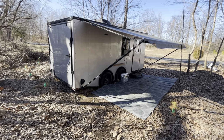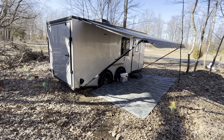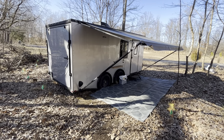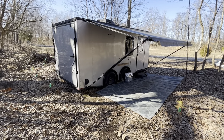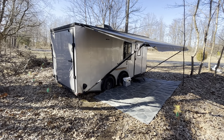As I mentioned, this is a spread axle trailer and I would highly recommend that if you have the option — in my opinion they pull so much nicer. These are the 5,200 pound torsion axles, so they're not straight axles, and it pulls very, very well.